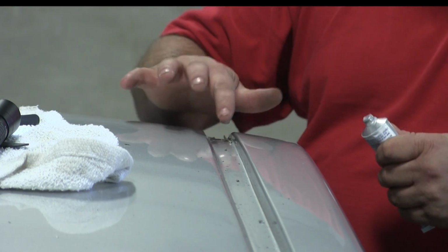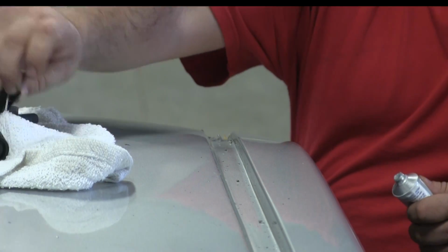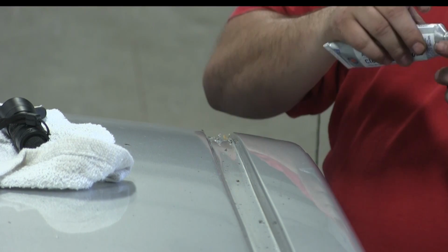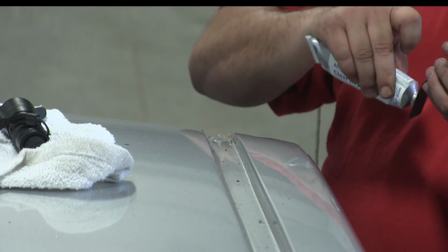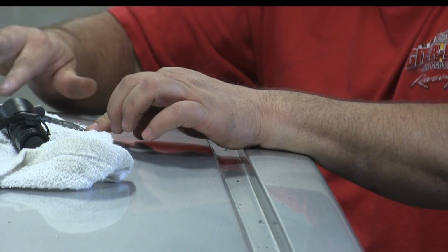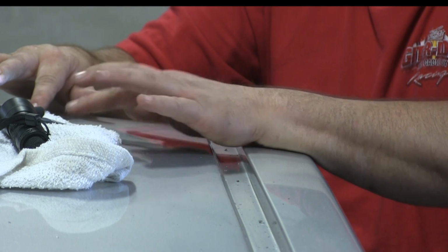Now the Nissan, it took a few more steps, a little bit more difficult than the GMC that we did. I don't know if you watched the video where we installed a light bar onto a GMC. It bolts onto the A pillars, but the way this Nissan is designed, it's wider up top. You can't use those type of brackets. It has to mount to the roof like this, and also having to use nuts and bolts made a few more steps, but overall it wasn't that bad.